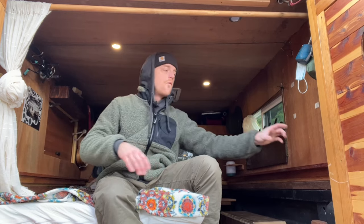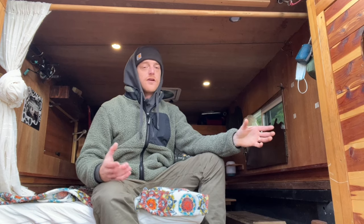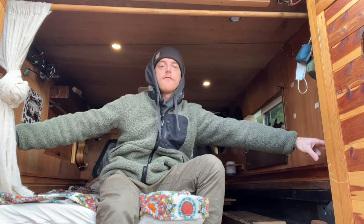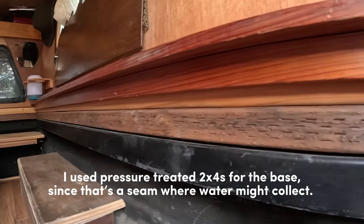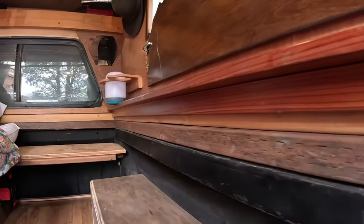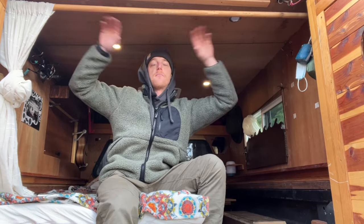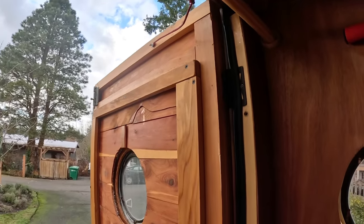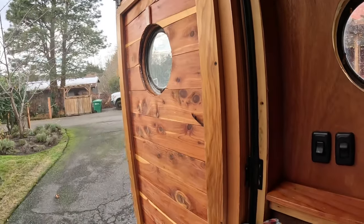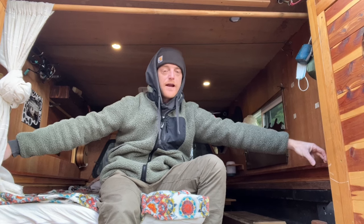In order to bolt the camper to the truck bed, I needed a wider surface on the rail than a two-by-two, and I also just wanted to make sure it was really strong. So I used two-by-fours laying flat on the rails, and built the rest of it up from there in two-by-two. The only other place I use two-by-four is in the uprights that frame in the back double doors — these doors are hinged on a frame that is screwed into two-by-fours that run flat against the back and connect down to the two-by-fours on top of the bed rails.